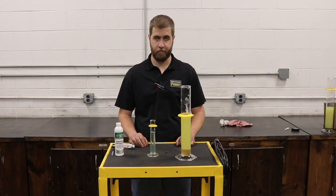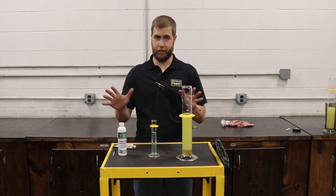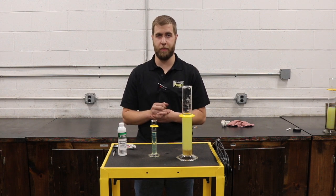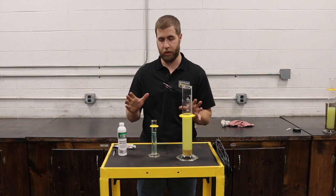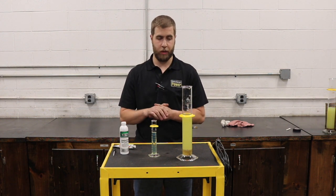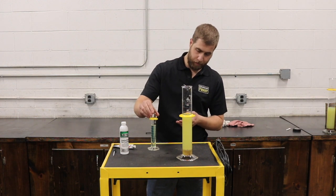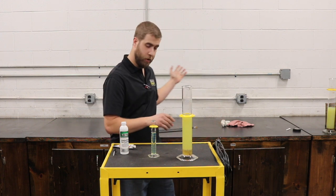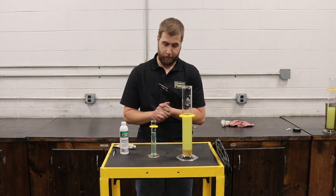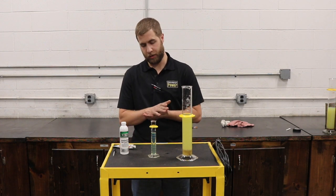Now let's do our water test again and see if we have any water left. That paste is still brown — so this solution, this treatment does a chemical reaction. I'm not going to get into it because I don't know it that well, but we're going to have a link in the description below to a video from Dieselforce from their chemist who gives a really good explanation and presentation of not only their treatment but other treatments as well. As you can see, it cleared up and there's no more water left in the fuel — this stuff is as good as good can be. We're going to let it set overnight and come back in the morning to do a quick shot and see what it looks like.